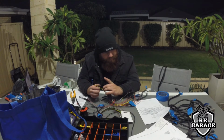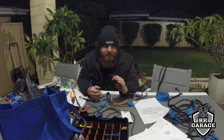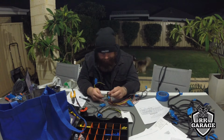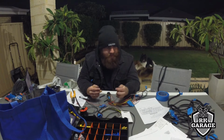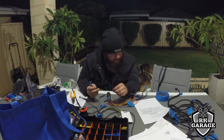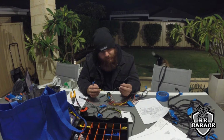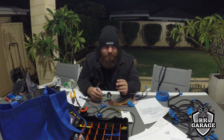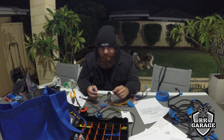There's also 5 volt outputs, which is this one here. This is going to have 4 or 5 wires going to it, all getting 5 volts. This one here is the sensor ground for all those, you know, map sensor, oil pressure, fuel pressure, TPS, I think IAT, ISC, coolant temp, we'll have them as well, I think, from memory. This is going to have quite a fair few wires going to it. I'm not sure if I'm just going to splice them all together or if I'm going to rig up a connector block for them. You guys will find out as I suss it out, pretty much.